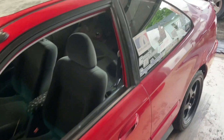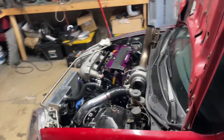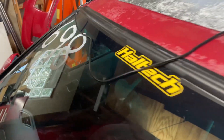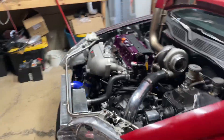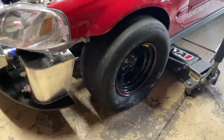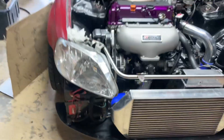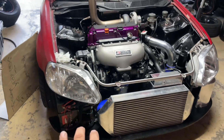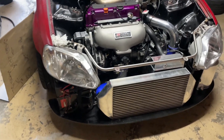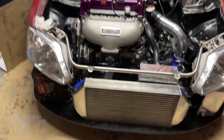I ran out of pump back here with a Hellcat pump. It has 2200cc injectors and it's on a Haltech 1500 ECU. It's running 24.5 by 9 by 13 slicks — so it's the recipe to go fast. It's got an 80-pound weight plate on the front, it's about 66% front weight biased right now, and I plan to add a little more up front and try to get some more weight out of the back. It still has sound deadener in it.